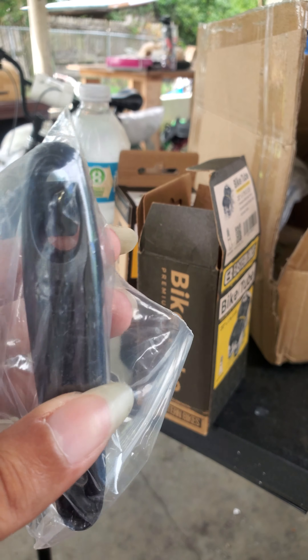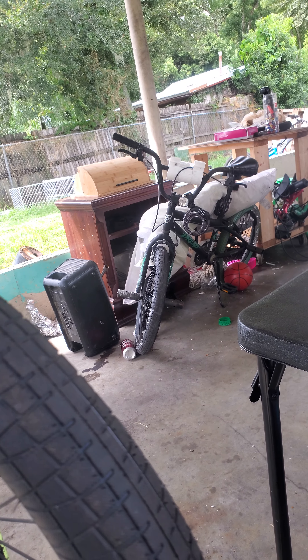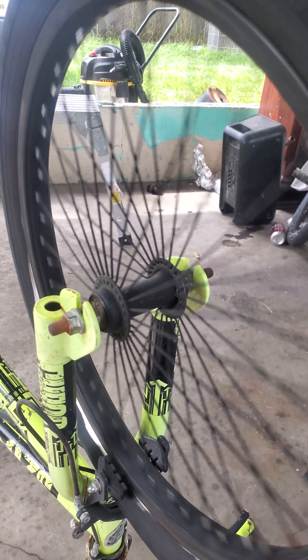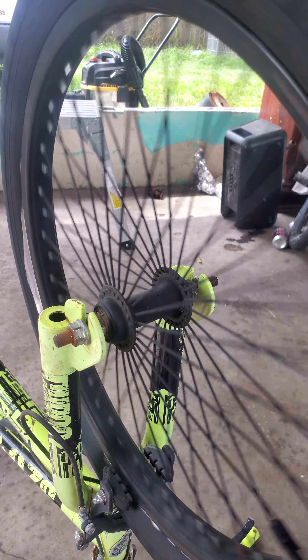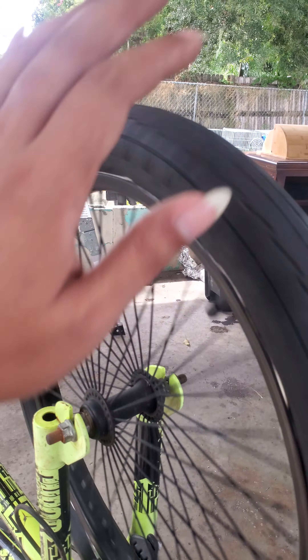Since I got all that, I don't even use the removal tool because I have this angle grinder — I have two angle grinder wrenches for it that I use to cut metal with. It has a metal cutting disc on it. I use those to pop open the tire off of the rim, to score around the edge just to make sure the tire completely removes from the rim.